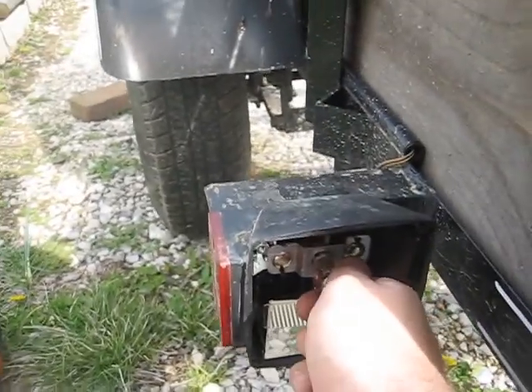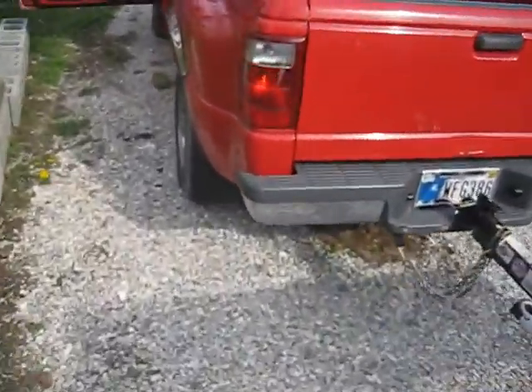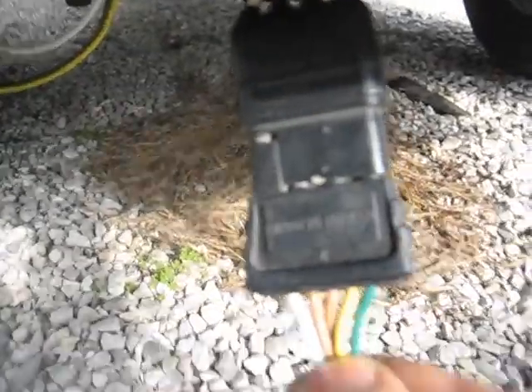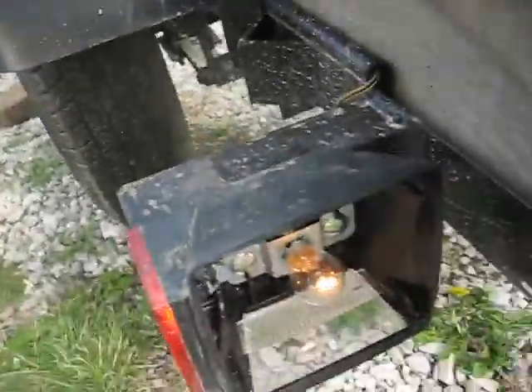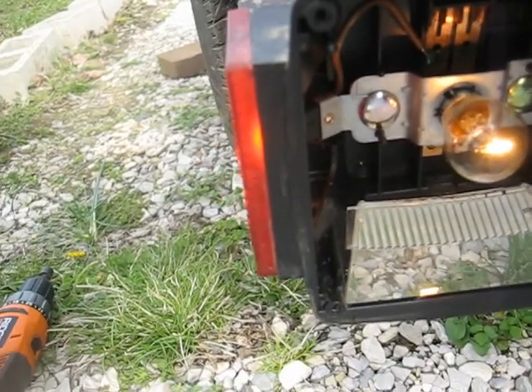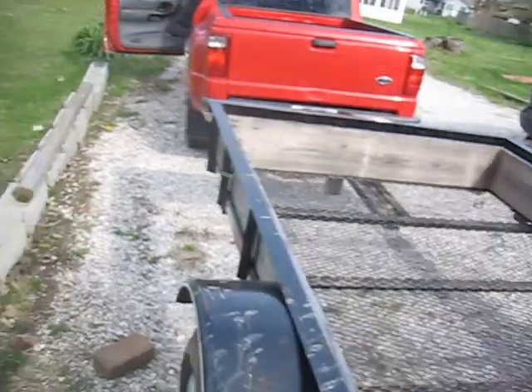The bulb's not working right now — we need to move the bulb. The bulb is fine, it was working a little while ago. Let's turn on the lights and check the connector real quick — connector looks good, wires look good. I had to rewire the trailer when I first bought it, which is why there's a lot of tape on it. Let's turn off the turn signal, turn on the headlights, and check the lights. We've got the side marker working so we're getting power back here, and the other side marker and tail light are working. This means we most likely have corrosion on the light bulb itself, so we'll take it out, clean it off, and put it back in.